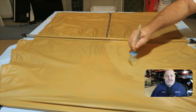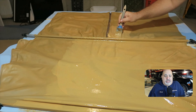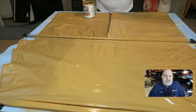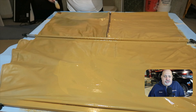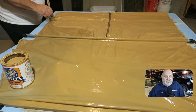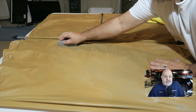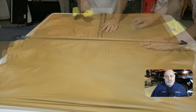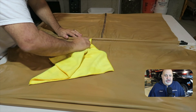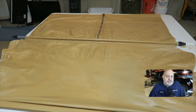Here's a second coat after you see how it dried. Again, I'm using the horsehair brush this second time. I'm going to get foam brushes for the other pieces — I just don't want to have brush marks in it, although they do fade away on this piece. I sand it between coats after they dry. I let this one dry overnight. And they recommend wiping it down with lacquer thinner very lightly — that helps the dye bond.